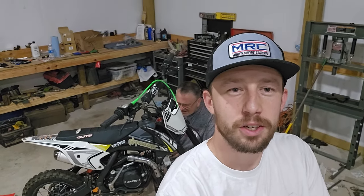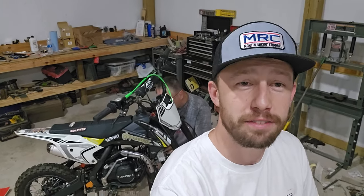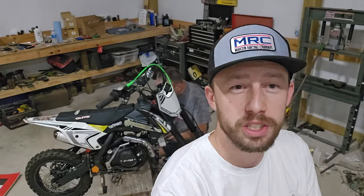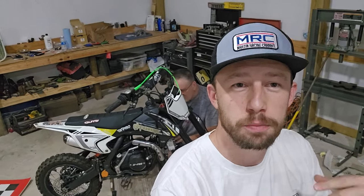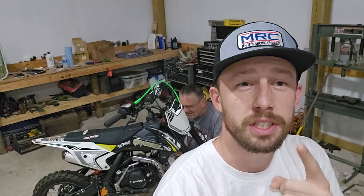In today's video, we're going to talk about something that you have to do before you ever buy a big bore kit or engine kit from TB Parts or T-Bolt, wherever you go. But three things you need to check. You need to check your cylinder height. That's one thing that slowed my build down tremendously. I ended up getting a 69 millimeter with a kit, and I needed a 78 millimeter.